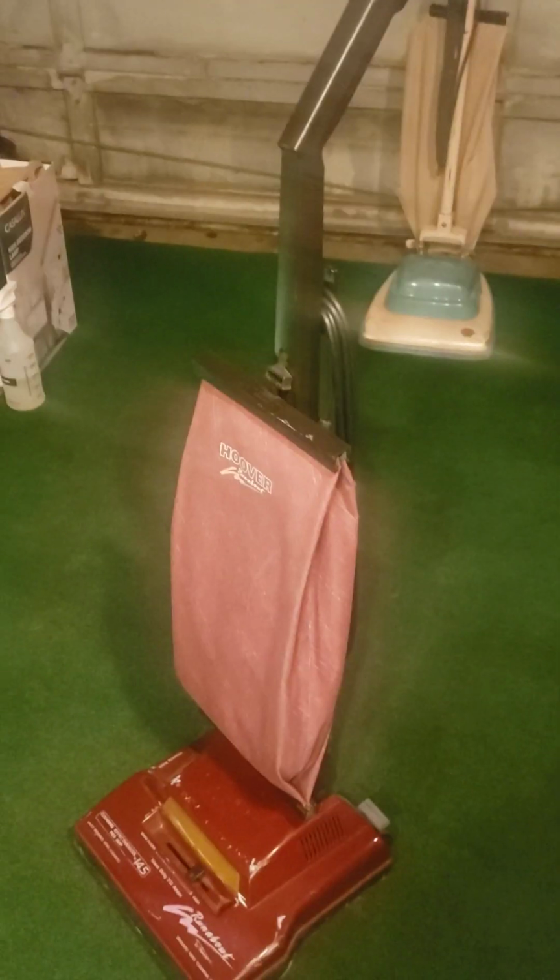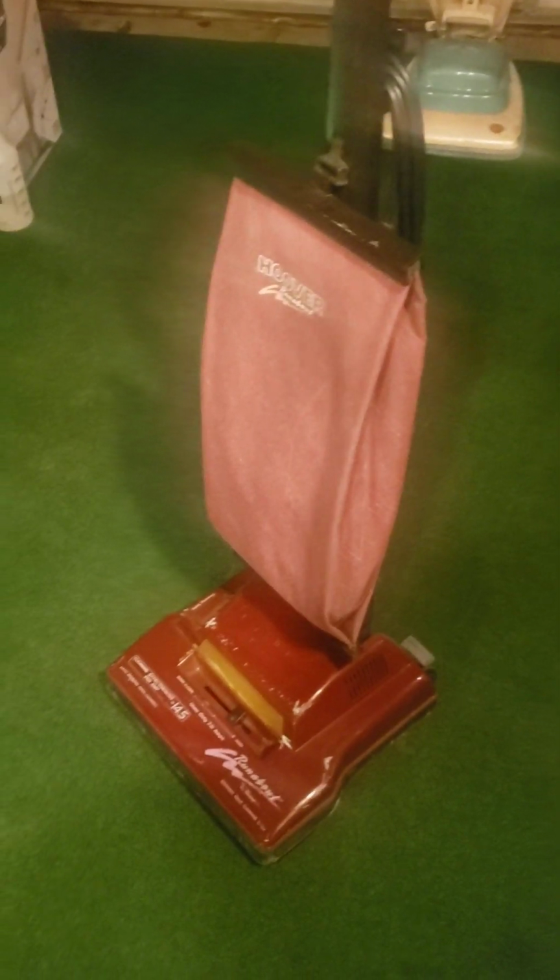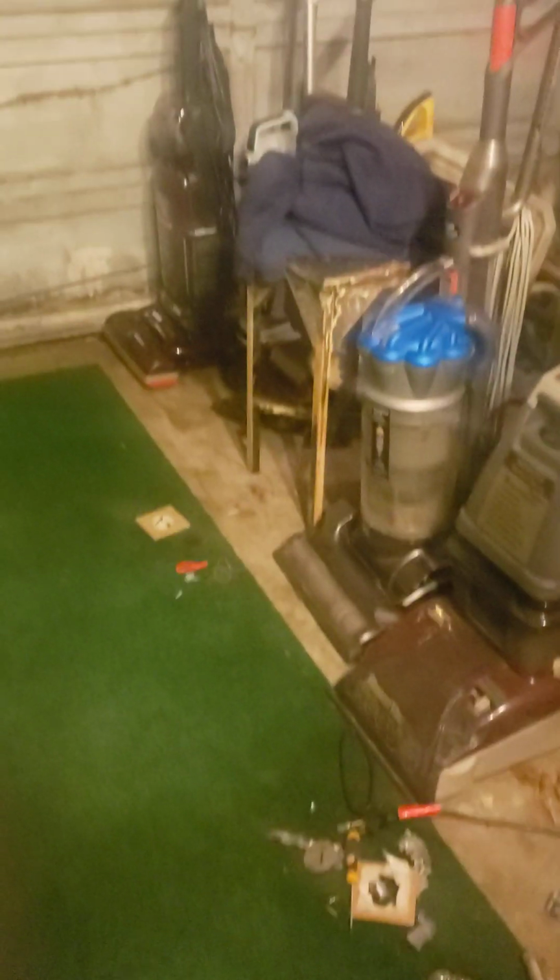And real quick, before I get started with this story time, I wanted to point out a major issue. I addressed this in the last video too with the Hoover wind tunnel, but there's a different issue that these Elite 350s have on their own. And if you realize, your belt is right here. So if we tilt the machine down onto its back here, this is the machine right here, and this is not your typical vacuum, okay? This is stationary. So, in order to remove the belt and maintain it, this top motor head comes off. That is how you maintain this vacuum.